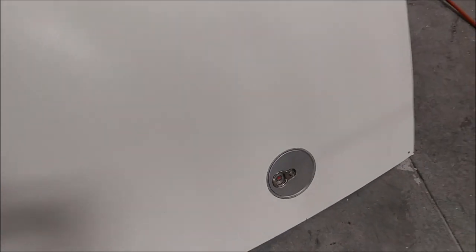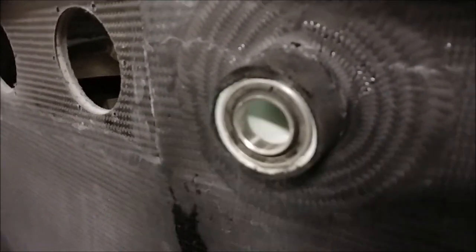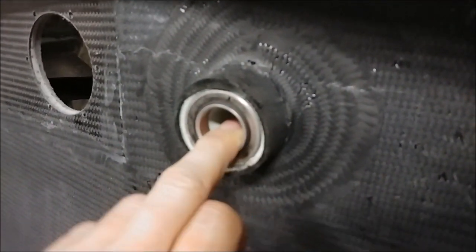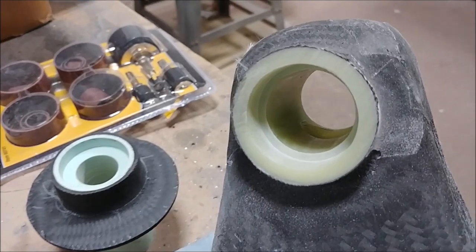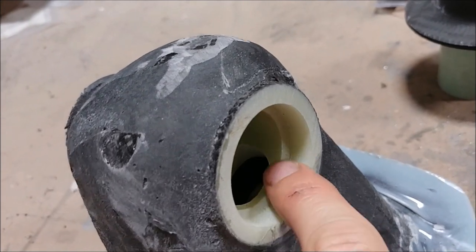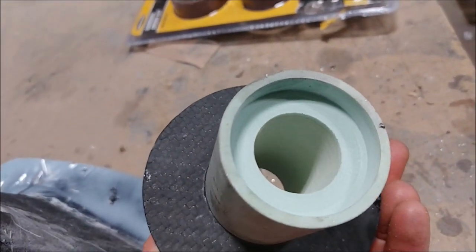Here are those larger fuel caps looking at the other side — they turned out really nicely. We were a bit worried they were going to look flat in that curved surface, but they fit really well. There's the elevator pass-through in the forward bulkhead — you can see the bearing in there. A rod will go through there, it'll be airtight, and that'll allow transfer of elevator motion in a rotational motion through the rod from one side of the pressure vessel to the other. There's the aileron one — that needs bearings pressed in, a few fasteners, and then it'll be screwed down into the keel, transferring aileron control through the pressure bulkhead without losing pressure. Behind it is the one for the rudder control, which will be bonded into the very forward part of the keel.